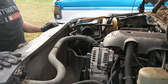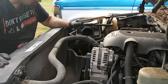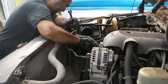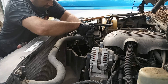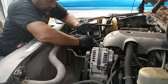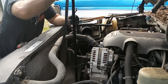Do I have a diagram on here? Yeah, I got a belt diagram right here. All right, 15 will work. Let's see which way we go — up or down. You're going to push down with it, I can just use this other wrench. Push it down, take it off of there like that. Slowly letting your tensioner off, get our belt out of the way.